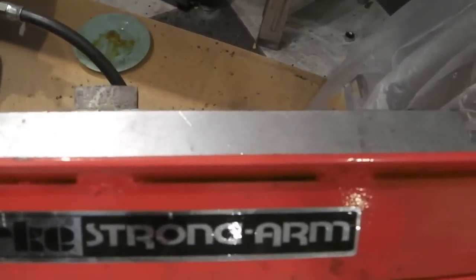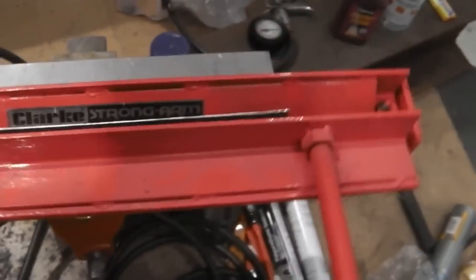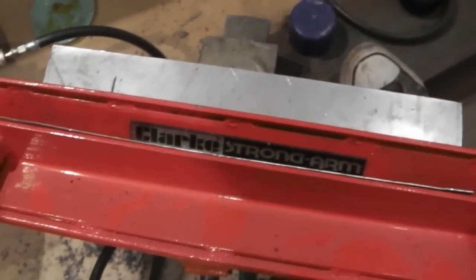I'm fabricating a repair piece at the top of the A panel. This is a right angle section that's going to go underneath the wing runner, and I'll just reinforce the top of the A panel. So I'm putting a 90 degree bend in that, sorry. There we go, to get the bend in the metal bender. Maybe just a touch more. We can just support that. Give us a right angle.